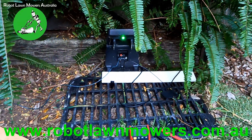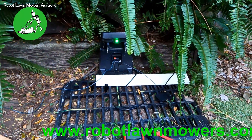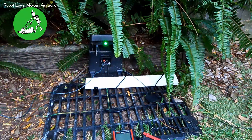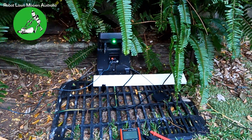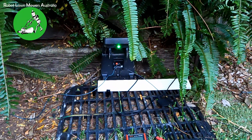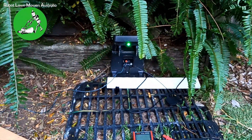If you've got no light, it's probably your power supply — it may have failed or you might not have power turned on. Check your power point with a drill or a lamp to make sure it's working, then plug the power supply back in and see if you get any light on the base station. If you still get no light, there's something wrong with the base station or the power supply.